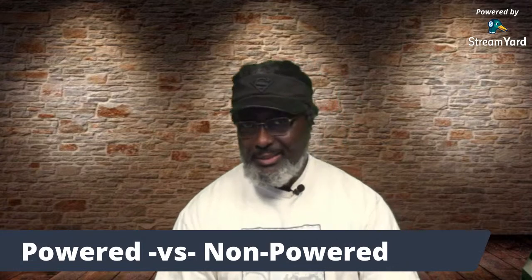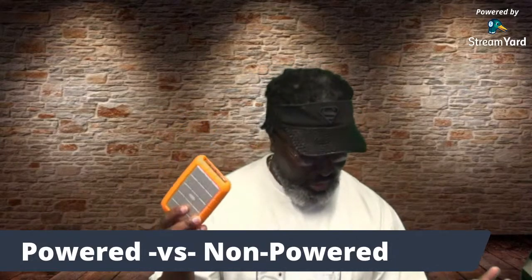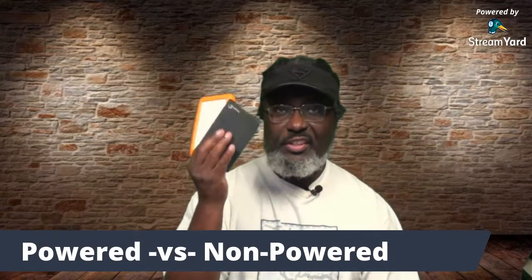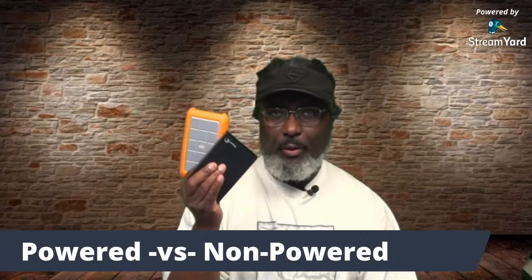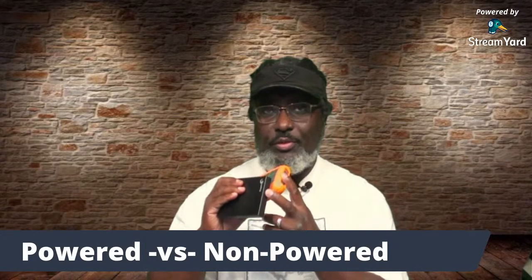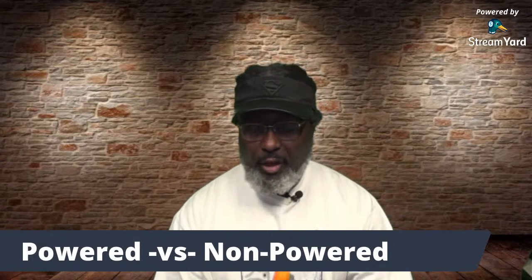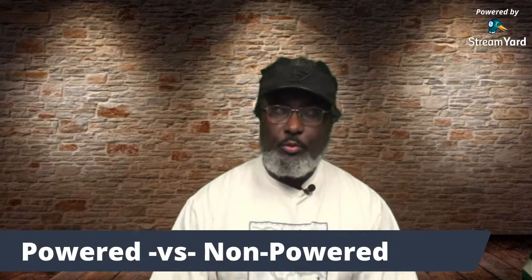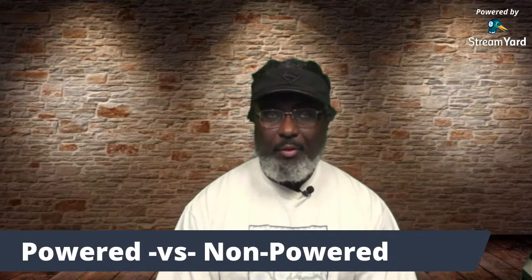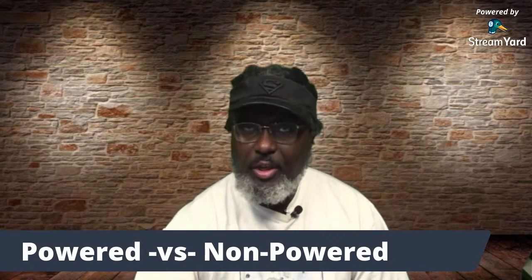So I just say stick to, and where's the other one now? This one. Stick to your non-powered or self-powered. These are self-powered. I mean, they can all have cable issues. Like if you're using cables that don't have the RF chokes on them to eliminate the RF frequencies, you could have that problem. The thing that you can do is just get cables with them, and that one, that's what I'm going to share as well.